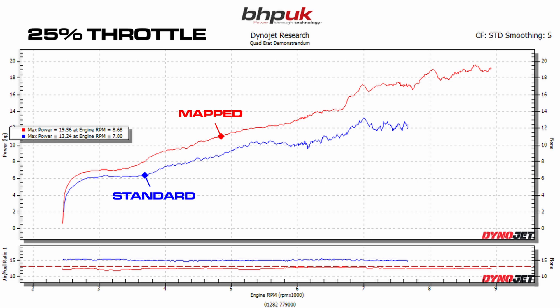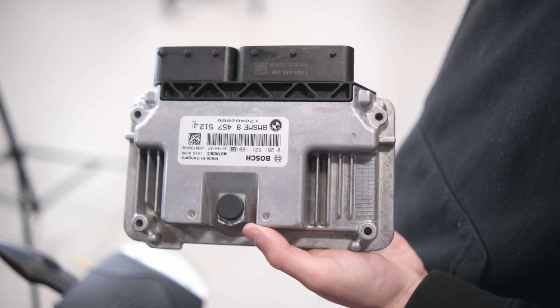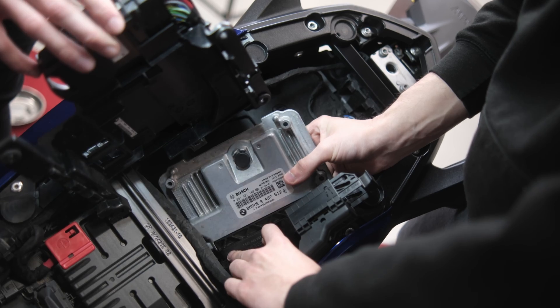The real gains are going to be in the throttle response. You can see from the fueling we've hit the datum line all the way across the rev range — the bike's just going to ride smoother, the engine's going to be smoother, and you're going to get a smoother throttle response. We've also reduced the latency. At the moment this is not available on our ECU flasher, but it is something we are working towards and we'll let you know as soon as we manage to do that. However, you can bring your bike to us and we can set it up on the dyno, or alternatively you can post the ECU across to us. It's a fairly simple procedure — it's just sat below the seat with four bolts to remove. Post it to us wherever you are in the world and we'll get that modified and sent back to you. Really hope you're enjoying what we're bringing to the channel — please do hit the subscribe, like, and bell icons to stay notified of any new BMW Motorrad content.